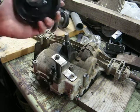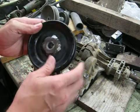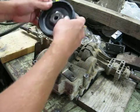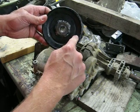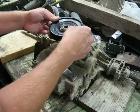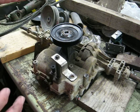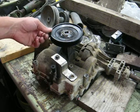This is about as small as you want to go — not only for ground speed, but you have to be able to take this pulley on the transmission to transmit enough torque on the belt surface area to get that power of the engine through the gearbox and to the rear wheels. The smaller you go, the less distance you have to contact the belt, and the less torque you can transmit, which equals less power. You can go faster as long as you aren't pulling anything, have a wet belt, go up hills, or weigh 250 pounds like I do. It's just a fact of design and the limitations of what a V-belt can do on a steel pulley.